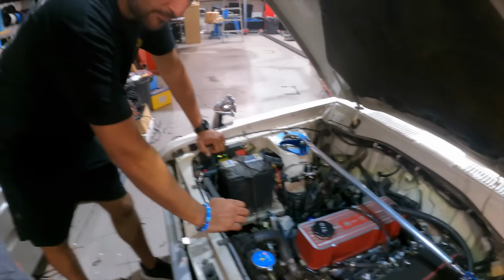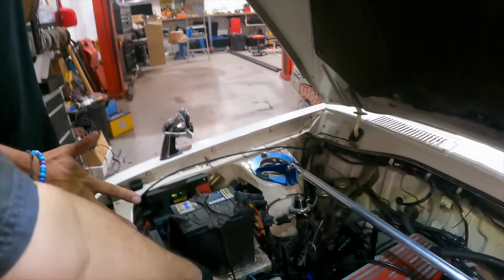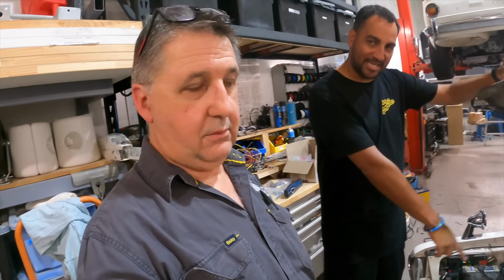Yeah, but, I mean, a nice little electric fan there, as you said, take the draw off the engine. Whatever is taking power away from my poor little A12. More aircon, less fan. Yes. And that's always convert that mechanical loss and change it into an electrical loss. Will it change drivability? Maybe. It's one of those things that people debate about on the internet forever. Like, if you take this off the engine and convert it into electrical, the alternator is going to be driving, so you put more into here, but does it actually put more into here?